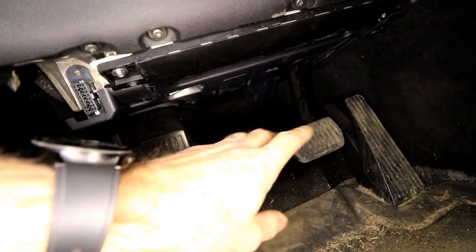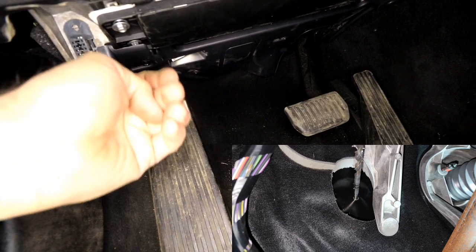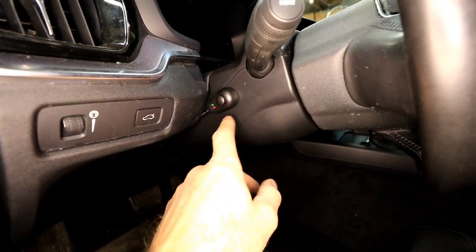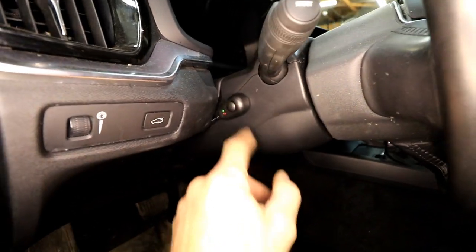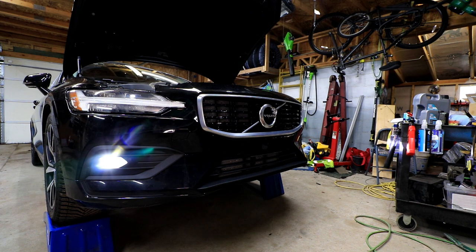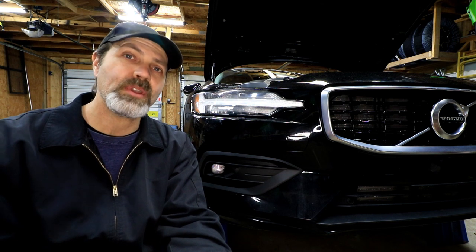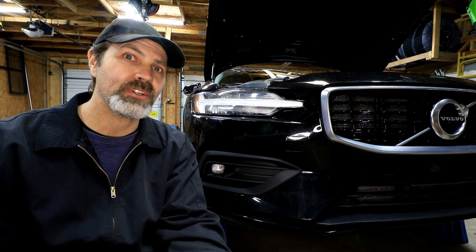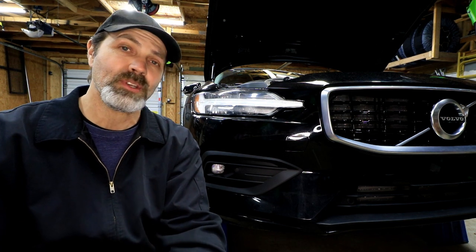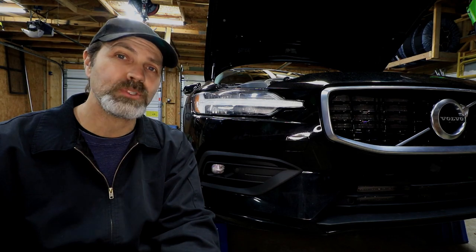Up under here by the brake pedal, there's an opening — almost like where a clutch would have been in this car. I was able to pull a little piece of insulation off and drilled my hole through. The wire just runs up behind the dash panel here and the switch is attached right on the side. When I push that button, it'll turn the lights on and off. That's how I went ahead and got my fog lights wired in. Again, it's manually on and off — if you have your high beams on, technically you should turn off the fog lights, but that's kind of a personal choice. I got them hooked up. Thanks for watching, and I'll see you in the next video.